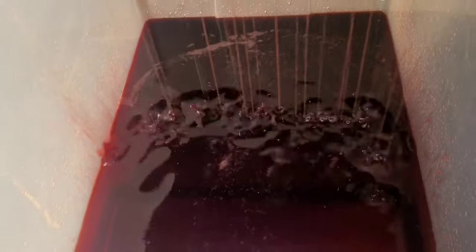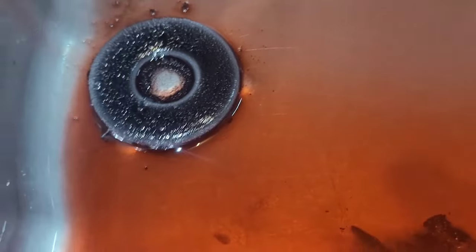This fluid has about 11,000 miles on it. All right, so here it is. This is where it's at. Metal shavings. Get that out of here. There we go. Metal shavings in the pan. So to get to this point, and you've got metal like this in the pan, that means it's got to be rebuilt.